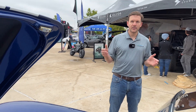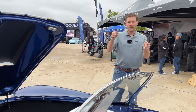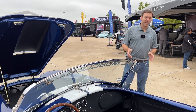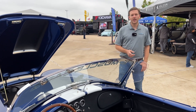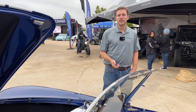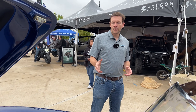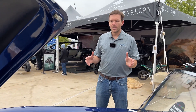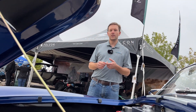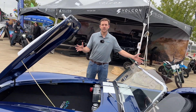If you've ever driven one of the older cars — 55 or 60 years old — they've got inaccurate steering boxes with quite a bit of play, it takes a country mile to stop, and the handling is questionable. We really like to add safety. Our battery boxes are all lined in crushed foam — the same stuff NASCAR uses in their doors. In the case of a collision, the batteries are protected. We use redundant electrical safety: each battery box has rollover switches and inertia switches, so if you get in a wreck, it shuts off all high voltage to the system.